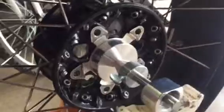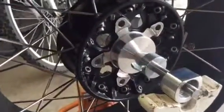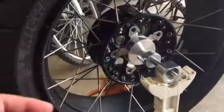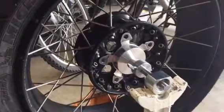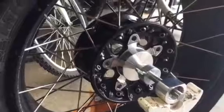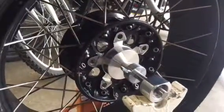This is how you balance: I just took blue painter's tape and start sticking weights on there until you get it balanced. Then you figure out how much you need, cut your strips, and apply them — they have self-adhesive backing on them, which is really difficult to get off. But that's static balancing.